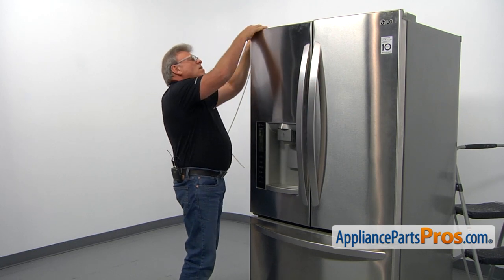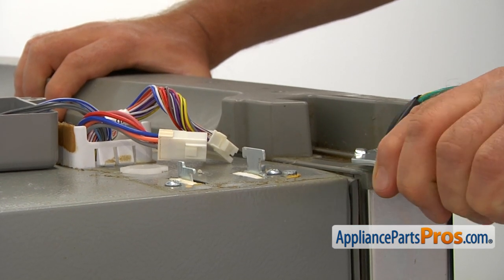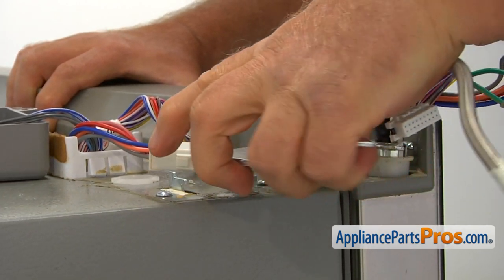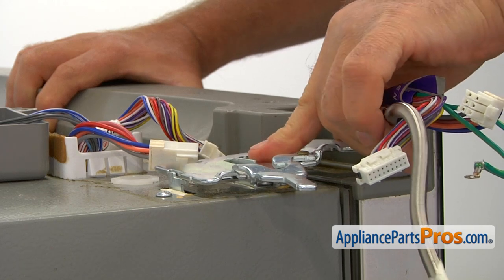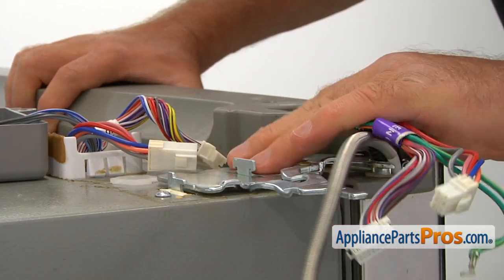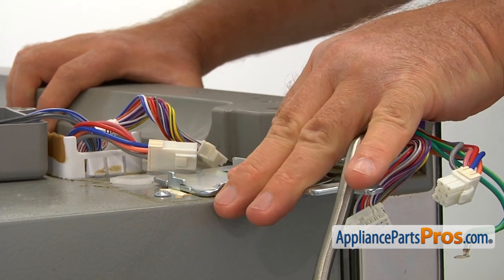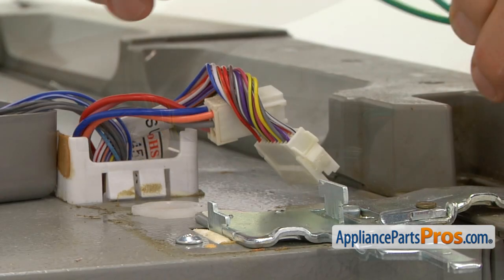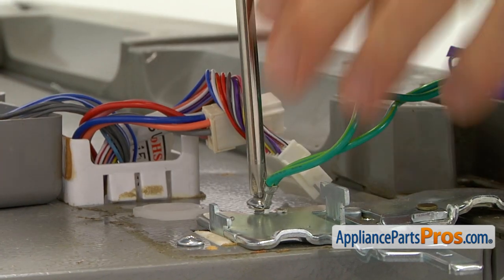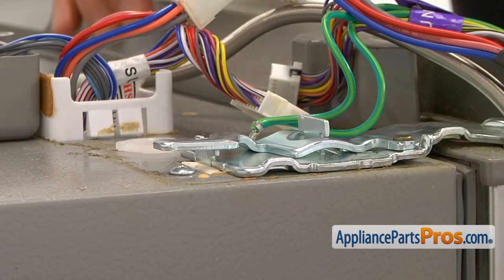And for the top hinge, we need to get up on the ladder. Now I'm going to pull up the upper hinge to kind of work it out. Then I'm going to swing it over and lock it over this tab and press it down. Slide it underneath here, and that assures that we are in the right position. Now we can connect the double green wire — that's the ground wire. I'm going to use a Phillips screwdriver. And now we can close the lever that locks the hinge.